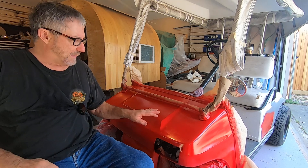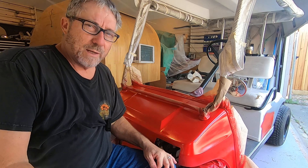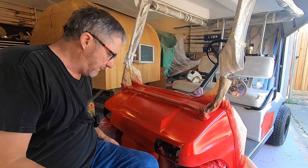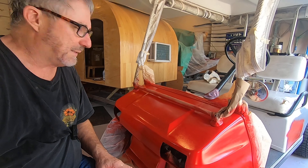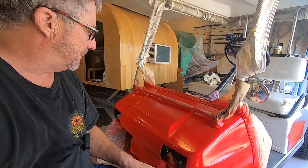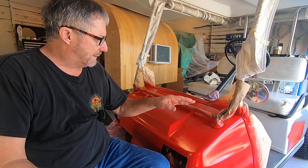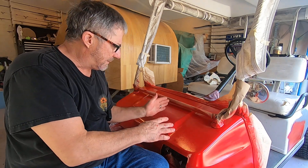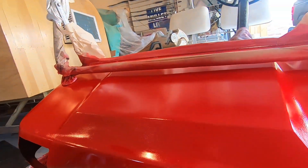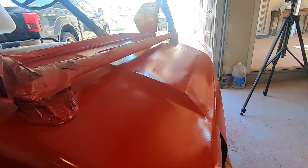But if you don't pay attention, I got cocky. After I sanded it down, I had a good heavy coat on there and it dried overnight. You can see here on the floor — I spent some time wet sanding, that's all red paint. I was thinking this is going to be a really good paint job, but when I started hitting it I was putting a moderate coat on and by the time I got to right about here I could see it starting to wrinkle up. It looked like one of those DIY jobs — just unacceptable.